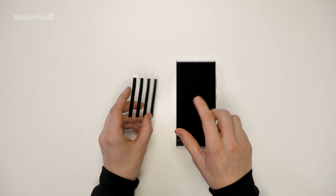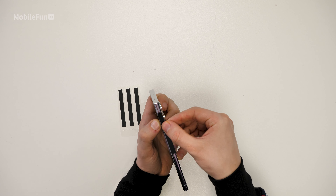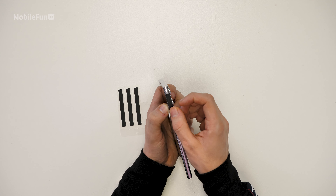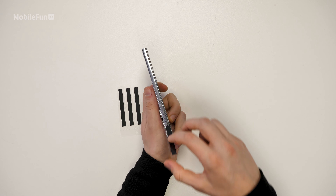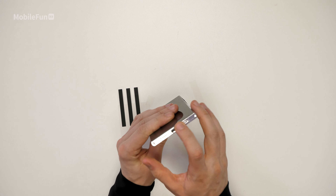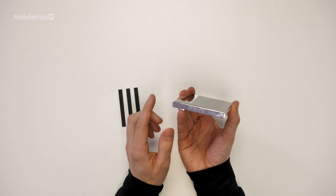The first step you'll want to do is install these black stickers to protect your phone from any liquid. To do this, just peel one side of the sticker so a little bit is showing. Pop them near your buttons and then just make sure they line up straight on the phone. Then, once you're happy, just turn them around and pull them down the rest of the phone to protect the buttons. Repeat this for the ports, the S-Pen and the microphones at the top of the device.